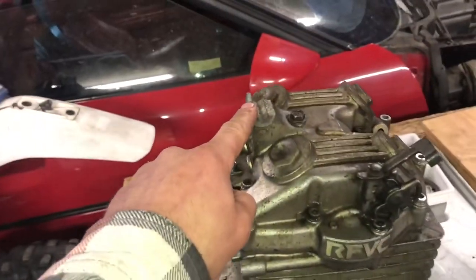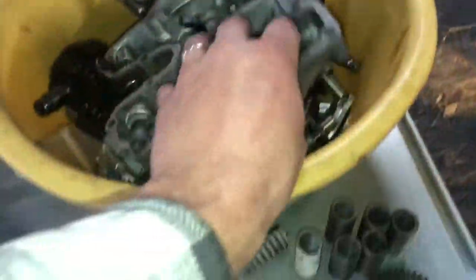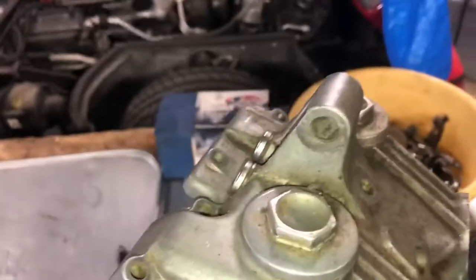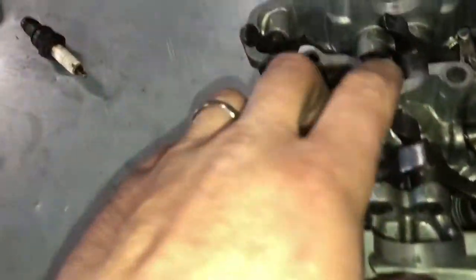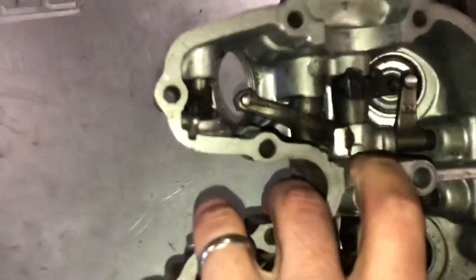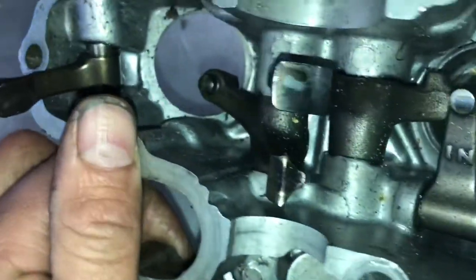With this broken part I'll be using the other one — that would have been a pain to find. With this one it's got a torched rocker arm — you can see the big flat rocker surface for the cam, and this right here is just totally burned off. So I'll have to swap that.